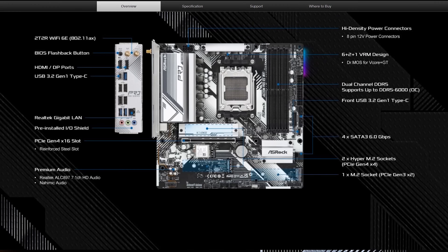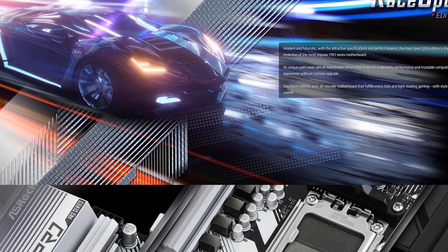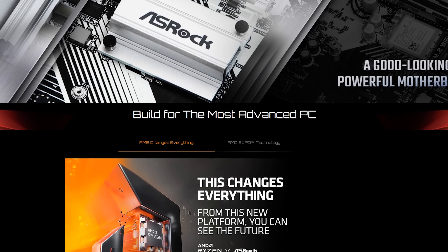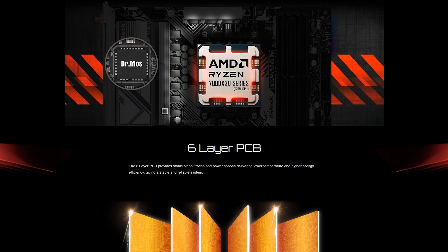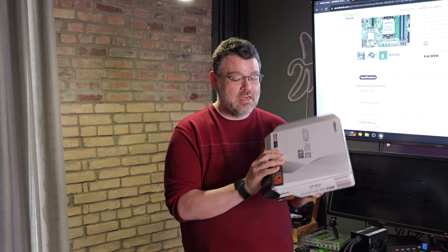There's also something like the A620M Pro RS Wi-Fi. We took a look at this basically on launch day but it wasn't ready yet — the BIOS has since been updated. This is the cheapest AM5 motherboard you can possibly get and it's not unreasonable performance. It doesn't throttle now, though it did throttle in the beginning. With a 7900, the A620M Pro RS Wi-Fi is a reasonable desktop board and it does have some BIOS features where you can say, whenever you lose power turn yourself back on, or turn on at a specific time — which can help with five-nines availability. But that motherboard is not really designed for 24/7, 365 operation.